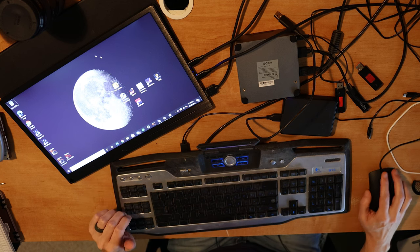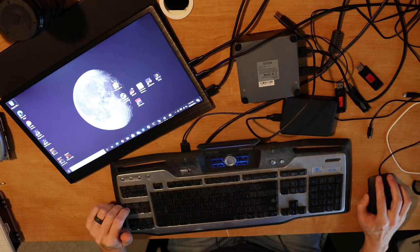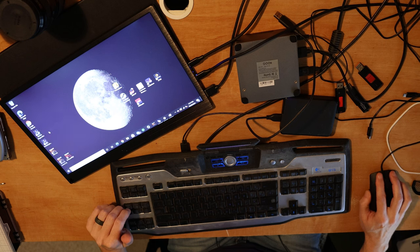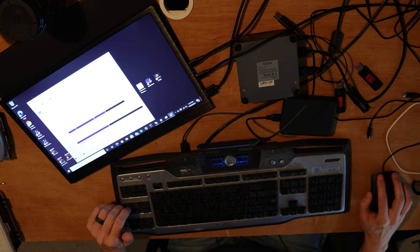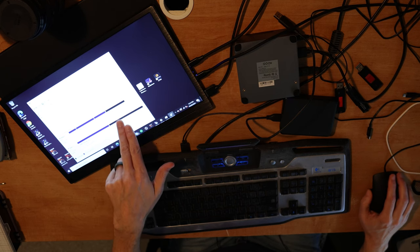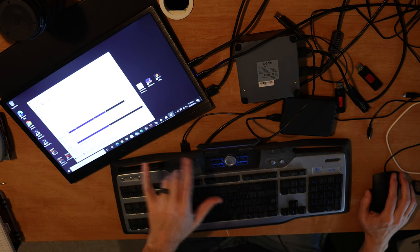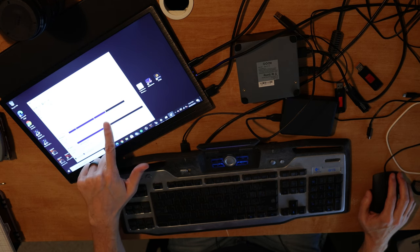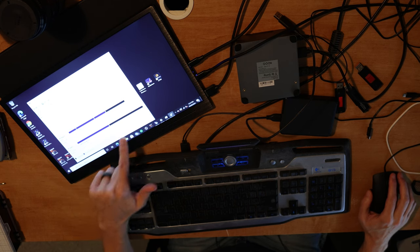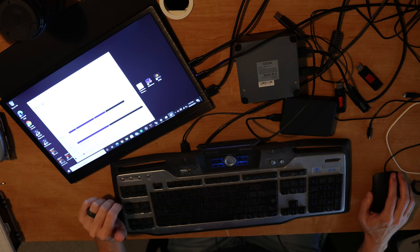And to help illustrate what we have here, I'm currently running Windows updates because I haven't actually had this on in a week. But let's go over here and let's do disk management. And once this pops in, you will see we have some unallocated space. So we got 61 gig of that 128 gig that's unallocated because the image that we used was only 64 gigs. And on disk one, we also have 465 gigs worth of space because we only had a 500 gig storage device before. Now we have a 1 terabyte.